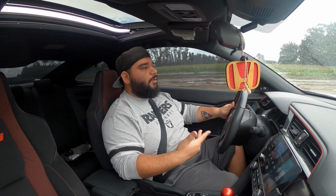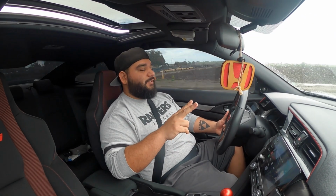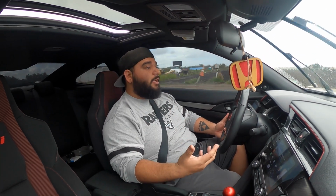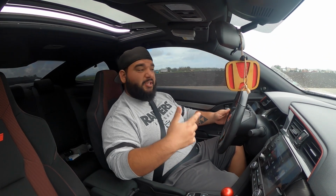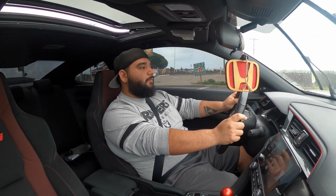I really don't. And that only happened when I had rev hang off on my Variable stage 1 tune when I was on 91, and on my Variable 2.5 tune when I was stage 2. And that's not talking bad about Variable. Keep in mind, it is an off-the-shelf tune, so it is not specifically for your car, it's specifically for a car. So that's why they're called off-the-shelf tunes. But regardless, it wasn't as smooth as this, which is funny because this is actually tuned by air fuel ratios.